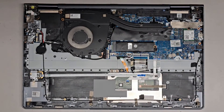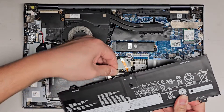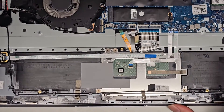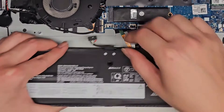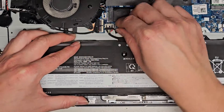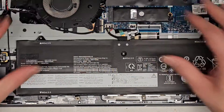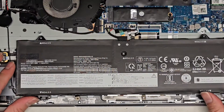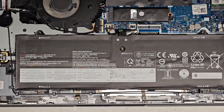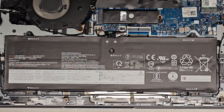I'm back. So we cleaned up the fan. We're going to put the new battery in and then reassemble this thing. You do need to curve the battery connector over. Let me zoom in a bit to show this better. Line that up, pinch that back in. I like to pinch both sides to make sure it's not putting all the force in one direction or the other. Then we're going to line this up and get the five screws back in, get the bottom cover on, and that's pretty much it.